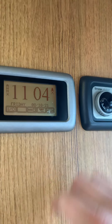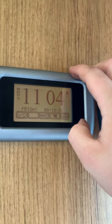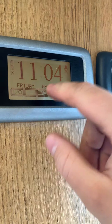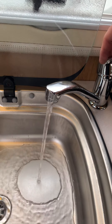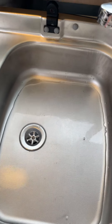Click the button to return so that'll bring you back. That button there turns your pump on — it's got to pressure, which means there is a little bit of water in the tank. This button in the middle says 'hab' at the moment, so basically everything in the back of the van, like your lights and all that, are working from your habitation battery — which is exactly what you want. Once you've got your pump on, come to your sink and just pull the water through to the hot and then round to the cold, and just make sure you've got decent pressure.